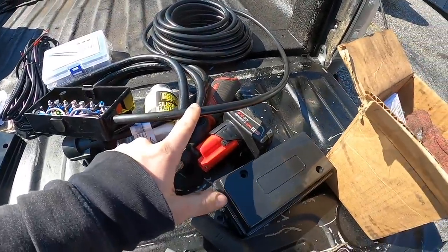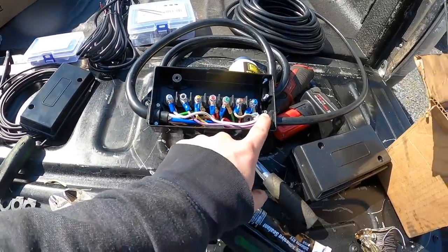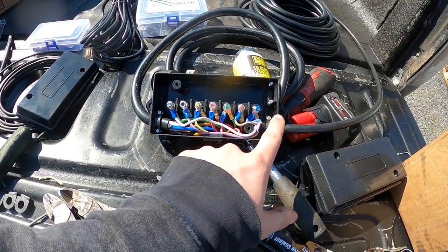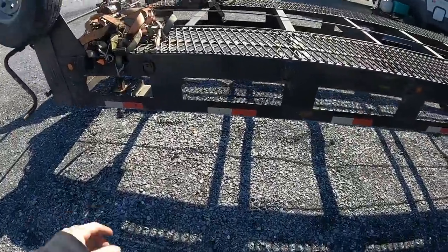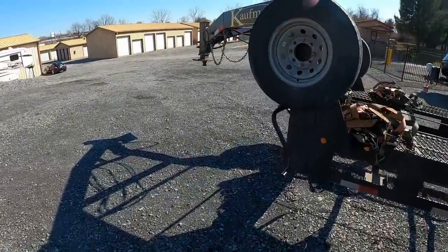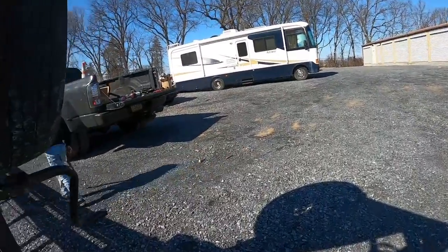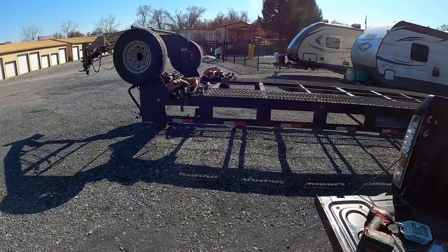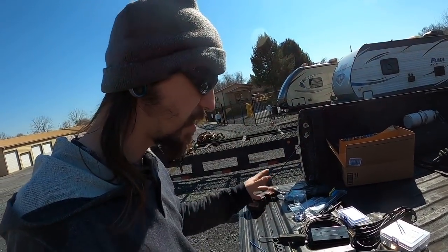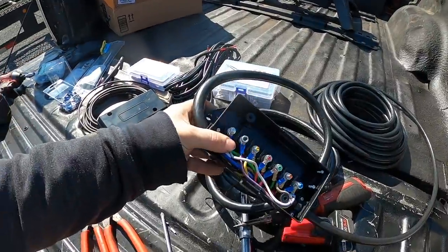I do see the big difference between this wire and this wire, so if it causes an issue we'll absolutely upgrade from 14 to 12 or 10 gauge. I got everything hardwired. The reason I like these junction boxes is I can come in from different angles. The brake wire hanging down there will come in separately from up here, and we'll also have a junction box for this guy up here. I'll cut and splice everything into the new junction box — if I don't get this done today we'll finish it tomorrow. I'm going to go mount this, start with self-tappers, then get it hard mounted with nuts and bolts.